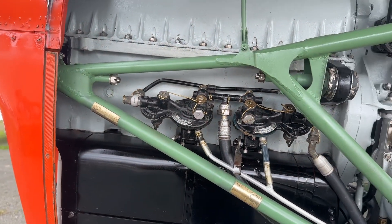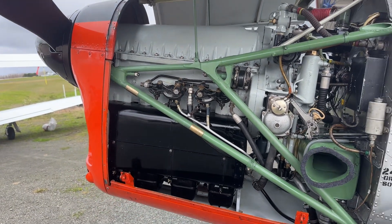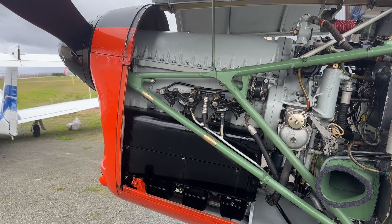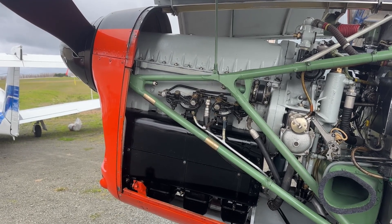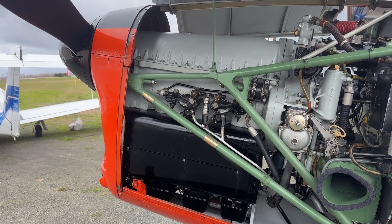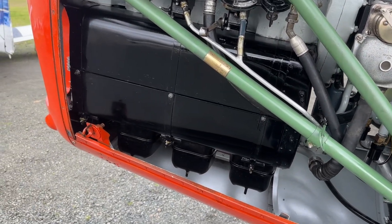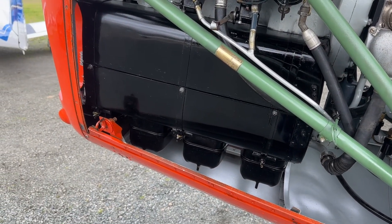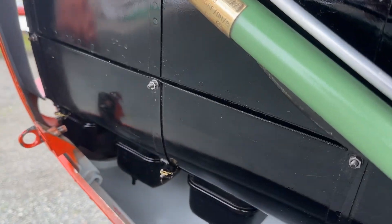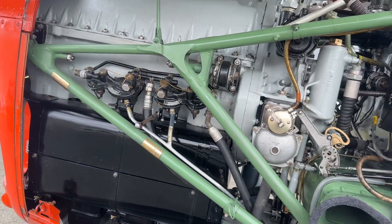The engine itself, giving the overview, is what's called an inverted engine. The reason it's called that is because the crankshaft, which goes from the back of the engine straight through to the propeller, is on the top. The cylinders and pistons are on the bottom. You can see three of the rocker covers below the rear three cylinders and pistons, with number one tucked up in front.